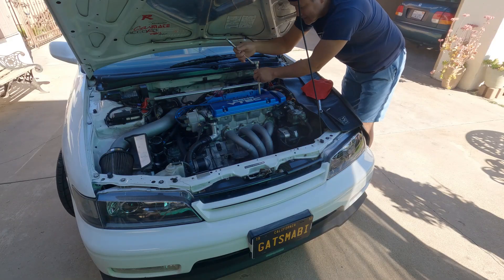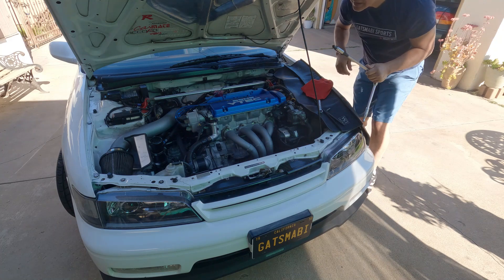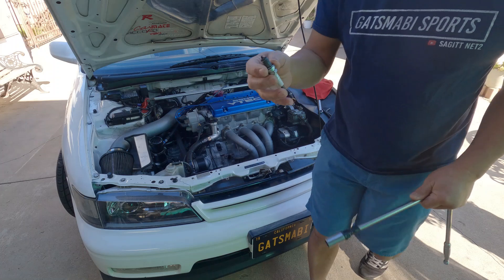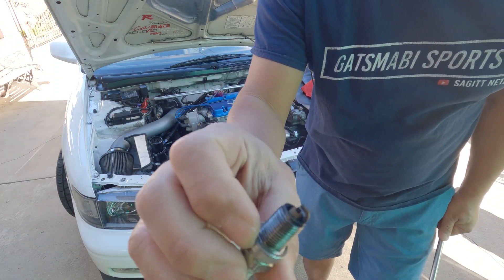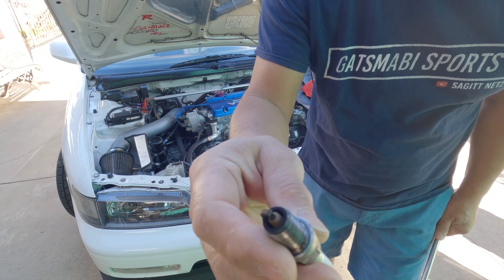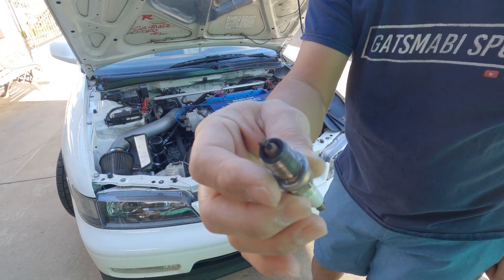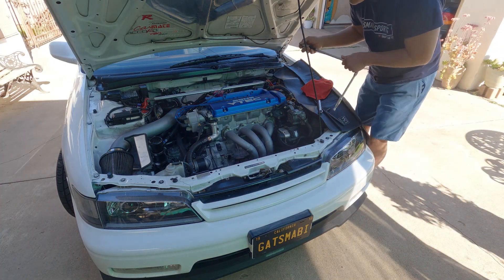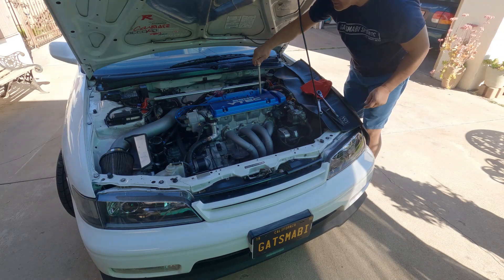This is the next day after the dyno night. I have buttoned all the things that I removed before I went to the dyno shop, and I want to see the spark plug and see what it looked like. I kind of saw blue smoke coming out from the tailpipe when he did the drivability test, but it looks okay. If there's any blue smoke or sign of oil from the tailpipe, I think it will be coming from the PCV valve.